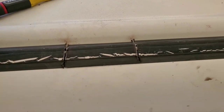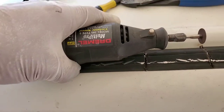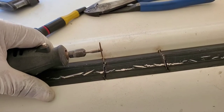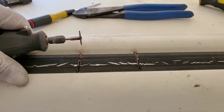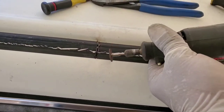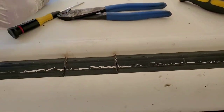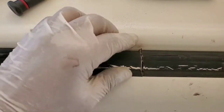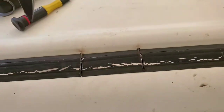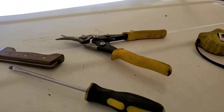One quick tip: when you're using the Dremel, grab it with two hands — one on the back and one on the front. Just in case it binds, it's not gonna whip and break the blade or nick your paint job. Do both ends — start from this side, go this way, then go across like that. One cut there, done. The other thing holding it together now is a little piece of rubber, or even a little piece of metal — I've got tin snips for that too.